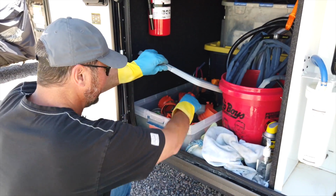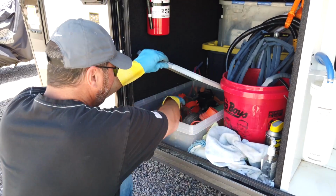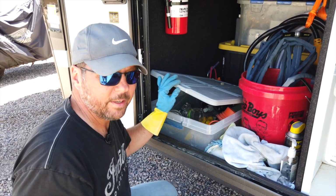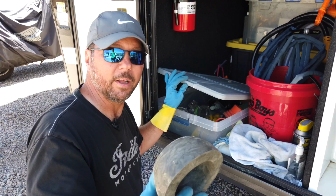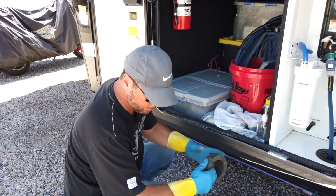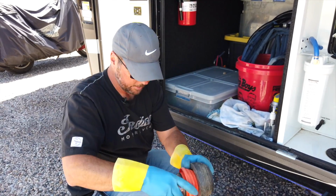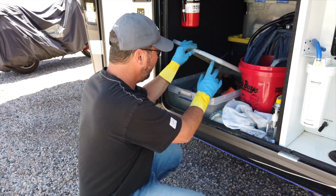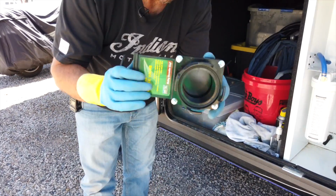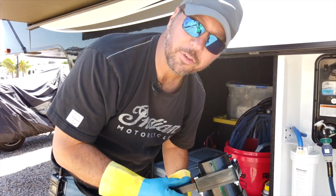So first I get all the connections I'm gonna need out. Gonna need the Y, gonna need the 90, a couple of clear elbows. Now, depending on the type of connection you'll have, you'll wanna have one of these donuts. Every now and then you get a connection that doesn't screw in, doesn't quite seal, and you'll want one of these, which goes on here, and you can put that in and get a nice good seal on it. We don't need it here, so not using it. Also, I keep an extra Valterra valve, and you can see how this works. I keep an extra one just in case I have one break.